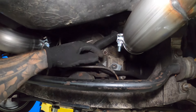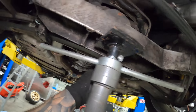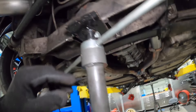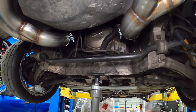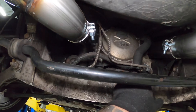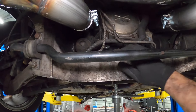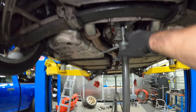It looks like there's probably been some service at one point. We've got two bolts under here — remove these two nuts, lift up the rear diff, and hopefully we can squeak this guy in. Essentially loosen these bolts off, we've got two bolts that go in there too, lift it up to get that out. This one was a hell of a lot easier than the front — all I did was take off the two nuts, take out the two bolts, and lift the transmission up.